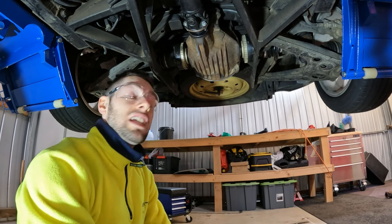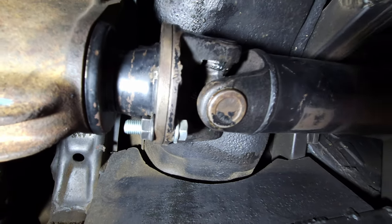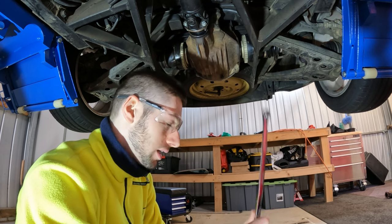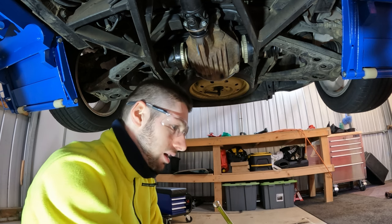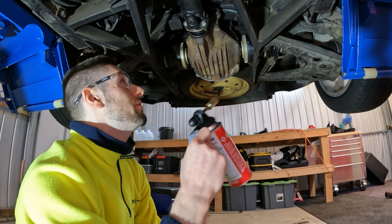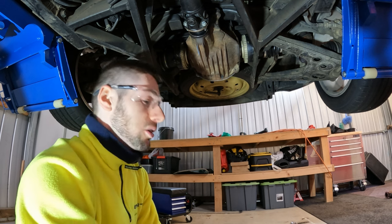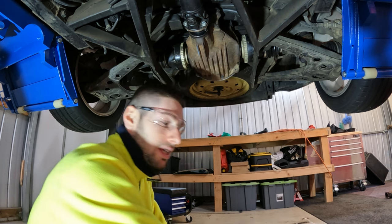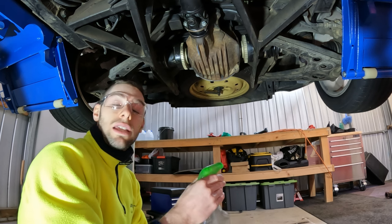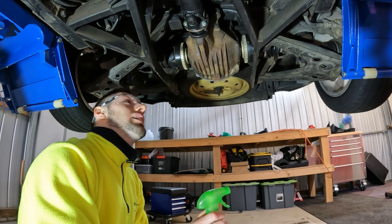This thing is very tight and I can't seem to get it off with normal tools. I've gone out and purchased an extended ring spanner, and I'm going to use a blow torch to heat up the nut and get it going. But because I used WD-40 and it didn't work, I have to get all the WD-40 off before I give this thing a hit with the blow torch. Hopefully it should come off.